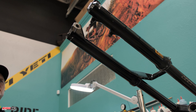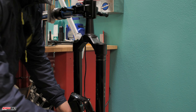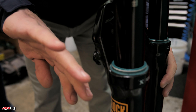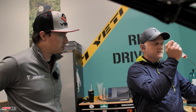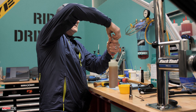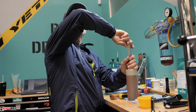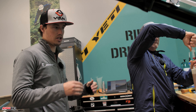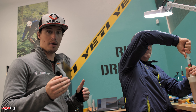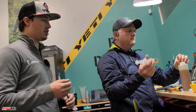An extra note when putting the lowers on: make sure the seal does not get folded under in any way, because that'll be a problem. Then put 10cc of Super Gliss — or your lower leg oil — in each leg. Is this universal across all forks? It's totally fork and brand dependent — if you're doing this yourself, you need to look up for your specific fork how much oil to use in each leg.